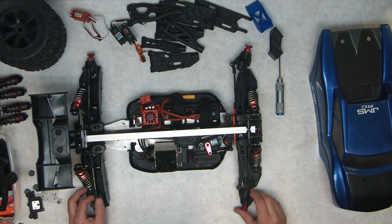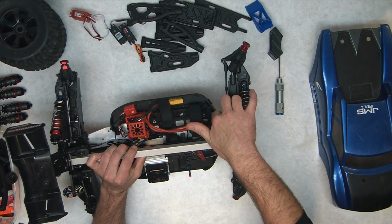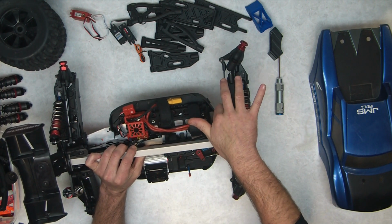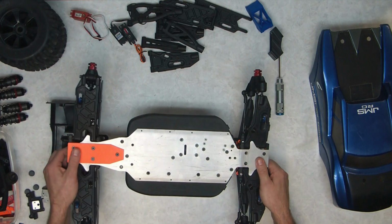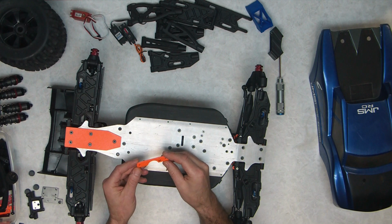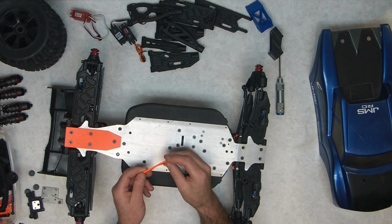Also, I bent a few of these Acumen steering plates, and the new one that I'm going to make is 4 millimeters thick instead. I do know that Corelli has released an updated version of this, but still, I think it's fun to design and 3D print stuff, and I'm going to try it out my way first. If I flip this around, I have also drawn up the hinge pin inserts, and I'm going to cut these out of a stronger material than aluminum, and I think that's going to work out really nice.